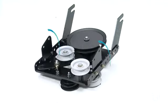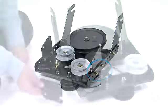Now attach the 2 front pulley frame brackets on either side of the clutch idler assembly. Align each bracket so the notch is on the bottom and closest to the edge of the assembly, and match the bolt holes to the 3rd and 4th holes on the side.